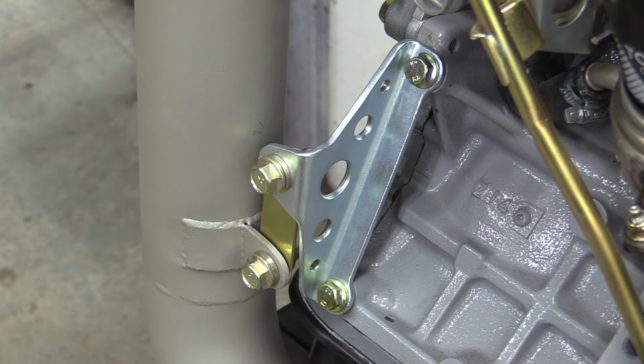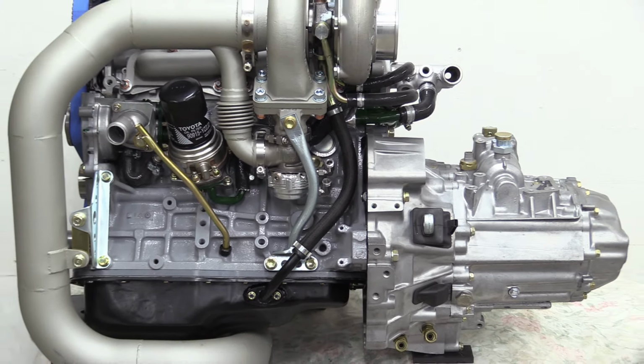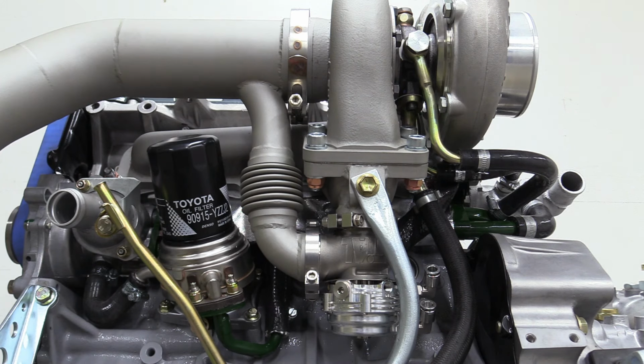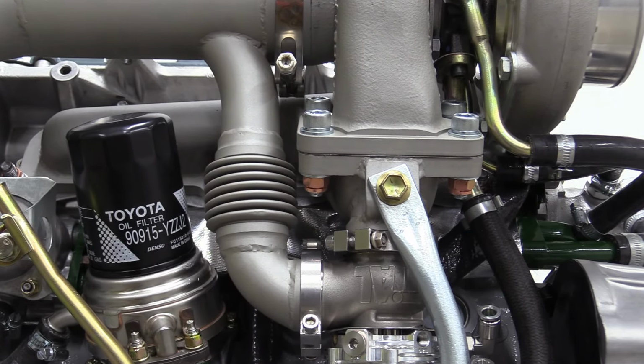You might be wondering why none of the exhaust system is done up tight. Well, it's because, and I don't think you'll be surprised by this, it's all got to come off again, as the turbo needs a blanket and the downpipe needs wrapping. We're serious about the underbonnet temperatures, so we're going to throw the kitchen sink at it. Not literally, that would damage stuff.